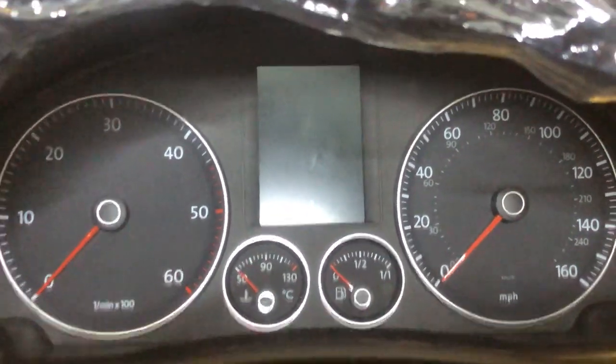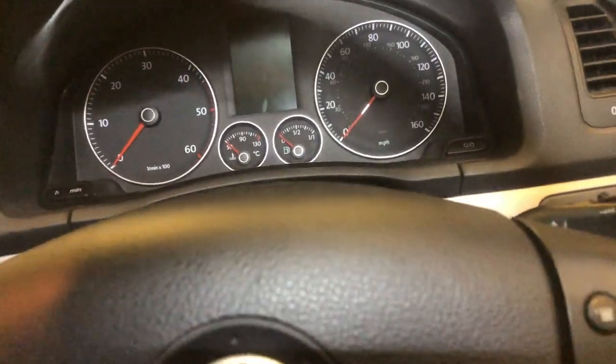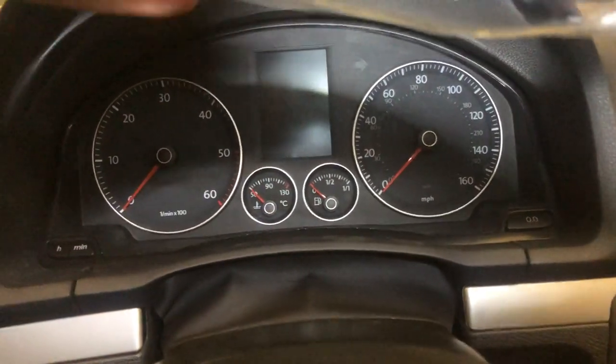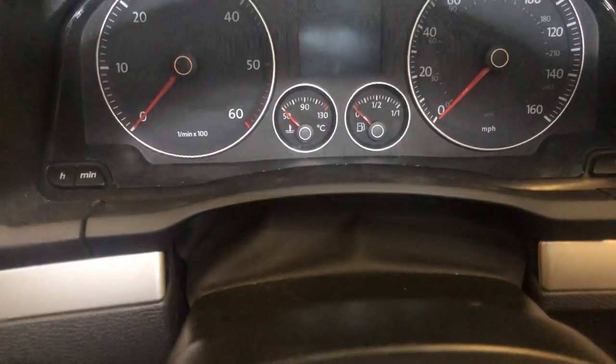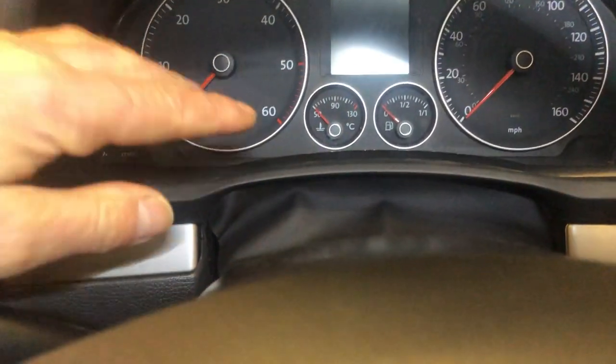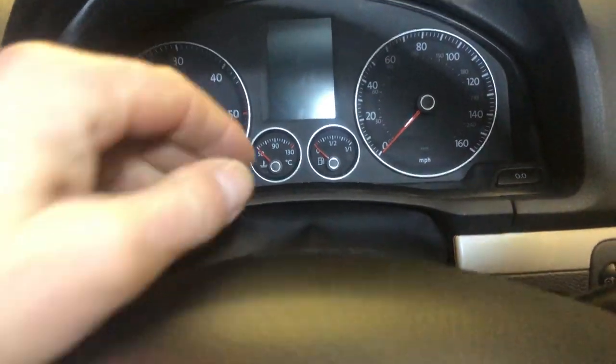And we have some better light. Now, I've checked all the fuses and they are as they should be. So we're going to whip the cluster out and have a look. This little lever here, first off, we're going to pull that down. And we're going to pull the steering wheel down and then pull it towards us as far as we can, and then lock it off again. That's to give us some more clearance to get the cluster out through this aperture here.